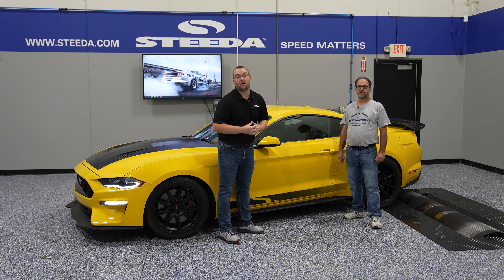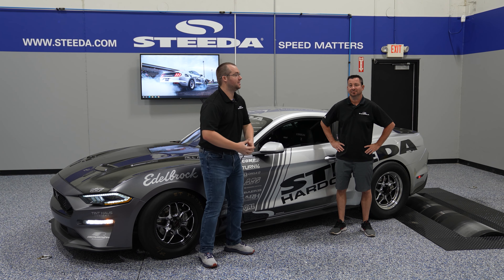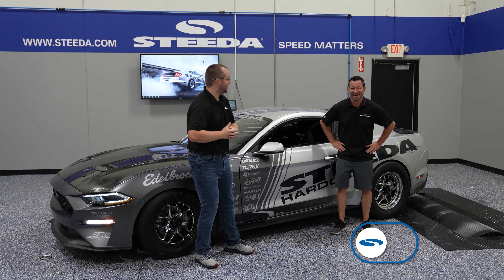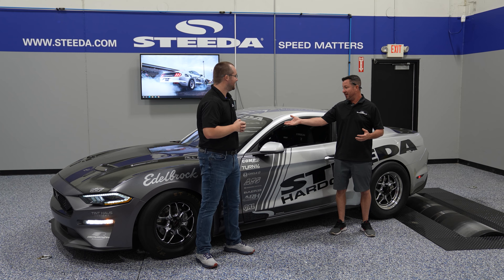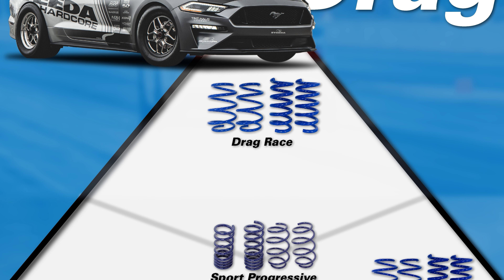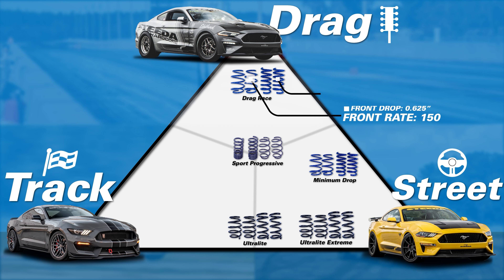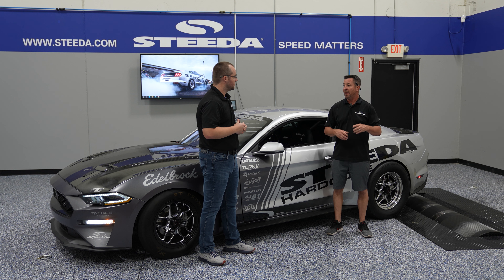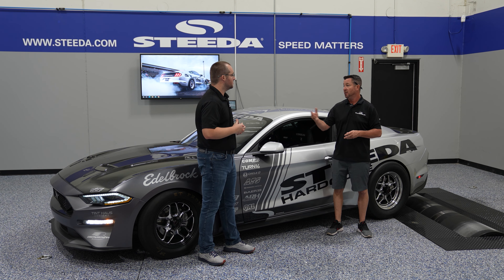Now it's time to move on to our drag springs. And what better person to talk about that than Scott Boda, our resident professional drag racer. We've got a Steeda Silver Bullet here that runs a set of our drag springs. For a long time we had the front drag springs on there. Now it's a coilover setup, but the rear drag spring sits a little bit higher than some others on the market, but with a big 29.4 inch tall Mickey Thompson tire we still have plenty of clearance. The beauty of the drag springs is they're super street friendly — if you like to go to the drag strip a couple times a month, they're not ruining your ride or the creature comforts of your car.